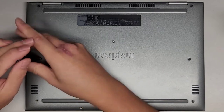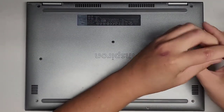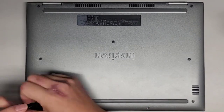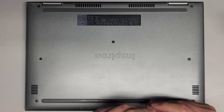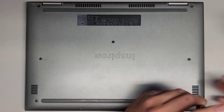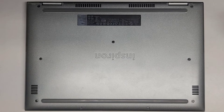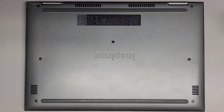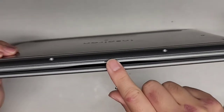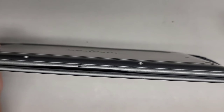We'll find out the exact model number of this Inspiron laptop — I'll probably just put it in the title. You can usually find it in the BIOS. We're going to test it on battery power and while it's plugged in to see how everything works. We're going to power it up and press F2 to get into the BIOS setup. In the battery information you can see: primary battery 100%, health is excellent, AC adapter power 65 watts. So you know the battery's okay and the AC adapter's okay. I see the service tag number but not the exact model number here — I'll figure that out later.